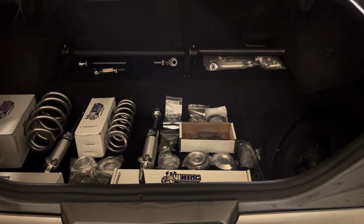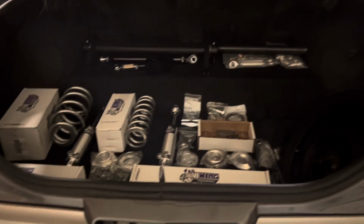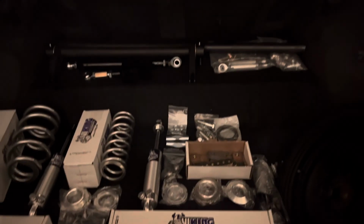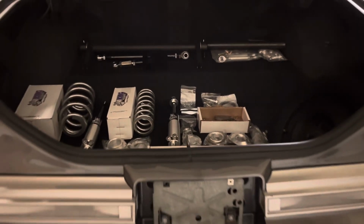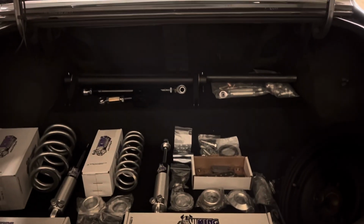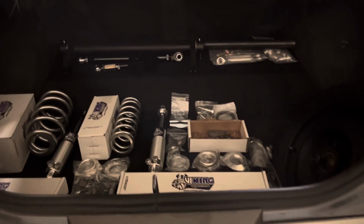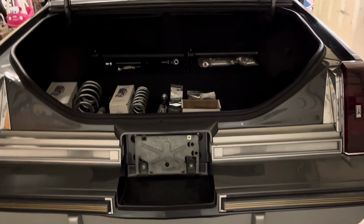That's what I do. So if you want me to do your car, you contact me and I will give you the list for the parts you get for your car. And I don't do that bolt-in rear coilover stuff. Bolt-ins, no. Welding is where it's at with the cross brace on top. And for a G-body, when you're doing the anti-rolls, plenty of room for G-bodies to have the anti-roll mounted on top the correct way. When you're seeing a bolt-on anti-roll that goes underneath the rear end, I can't do those.